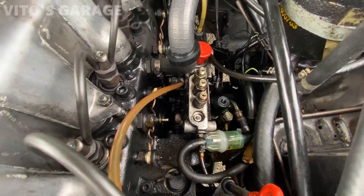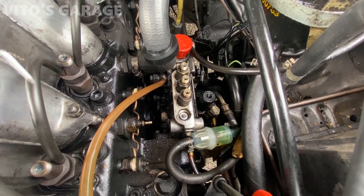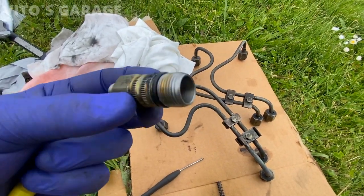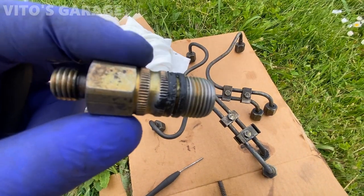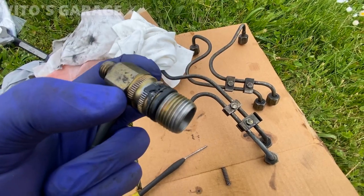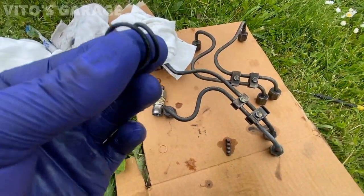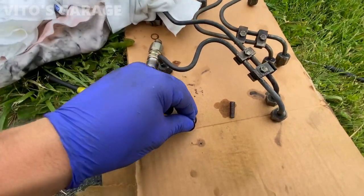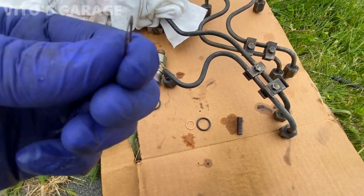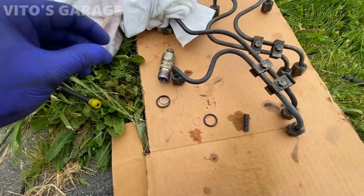I'm going to be really careful and clean this area with a clean towel. So here's the first delivery valve — there's a crush washer inside we have to change, and this O-ring is in pretty bad condition. That's most likely why it's not starting correctly when on an incline. Here's a quick comparison of new versus old O-ring. The new crush washer goes on — this is the old one. The old O-ring is not brittle but it's flattened out.